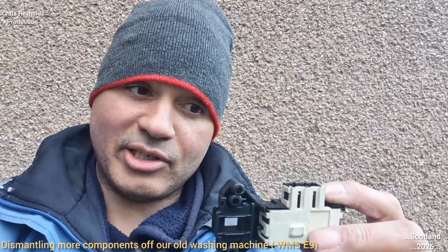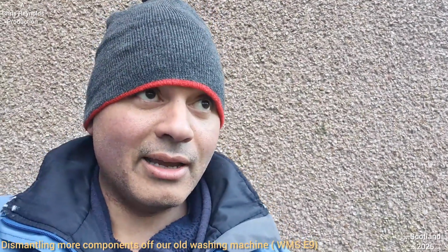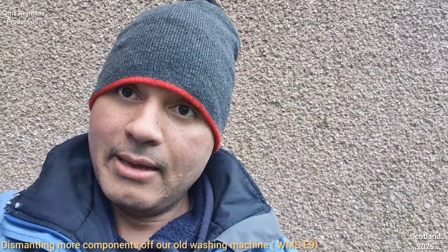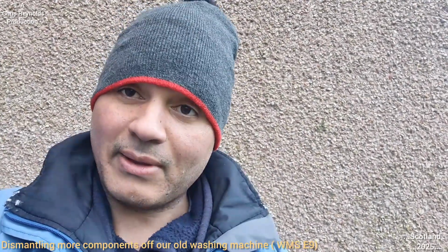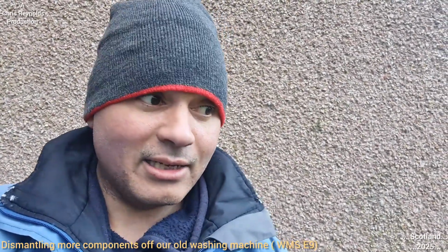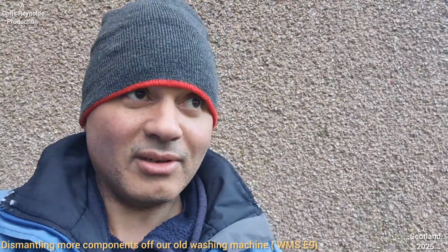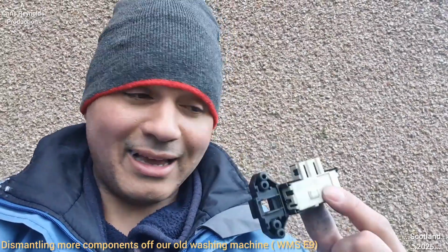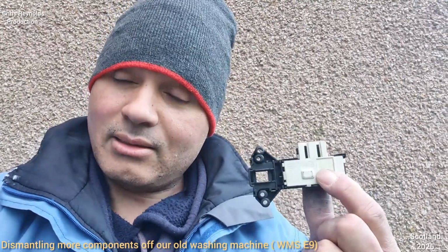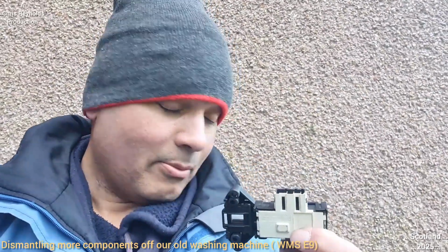So you try and pull it, it'll not open, because this is a safety measure, and it's for kids and that. Because the water in the machines could go up to 90 degrees centigrade, which is pretty close to boiling hot water. So it doesn't bear thinking about what could happen. And the spin on that could go up to, the motors are nearly a horsepower. So you just imagine what would happen if you accidentally open the door while it's in use. So that has got to be there. It's just to make certain that that door will not open when the machine's in use.